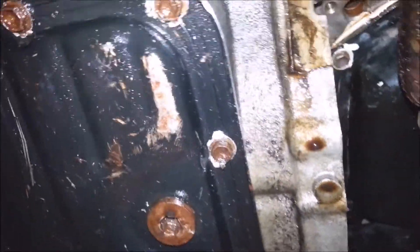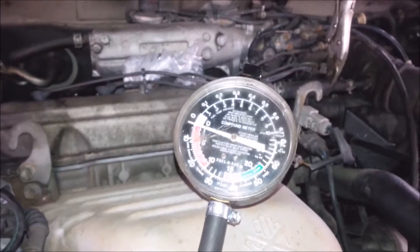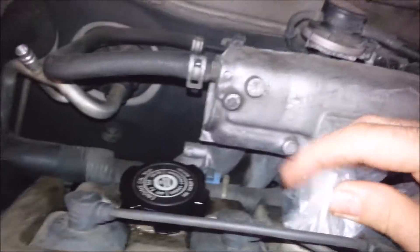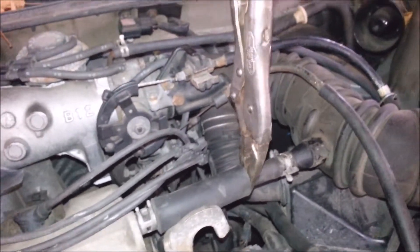I'm going to show you how to try to find an oil leak on a car using crankcase pressure. I've got a vacuum pressure gauge that's hooked up to the oil dipstick tube, as you can see there. What I do is I blocked off the PCV valve - I pulled it out and just put a plastic bag on it and stuck it back in. Then your breather, you block that off with a vice grip or whatever you want to use, and that seals the crankcase.